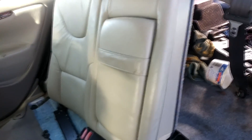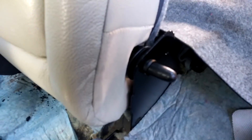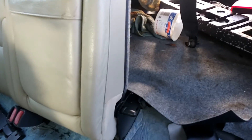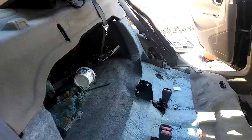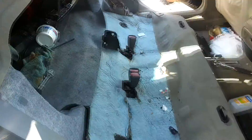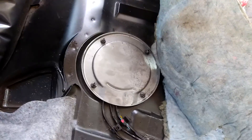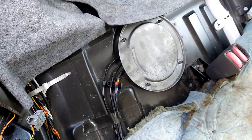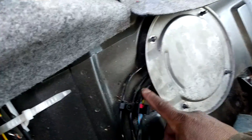The big seat on the passenger side will look like this. In order to get it out, you got this big plastic clip. Just slide it over towards the passenger side and it should come out. So now we got the seats out, and on the passenger side, peel back this cover and this little panel is your fuel pump. I think this is 10 millimeters. Let me get that cap off. Once you get the bolts out, pull the silver cap off. This flat rounded side goes over the wires.